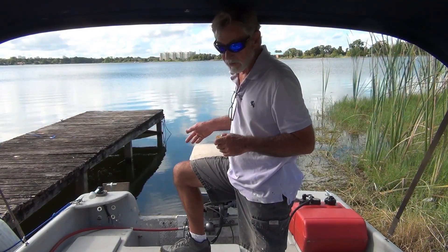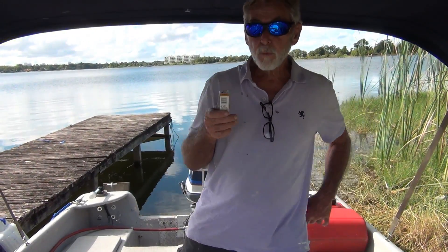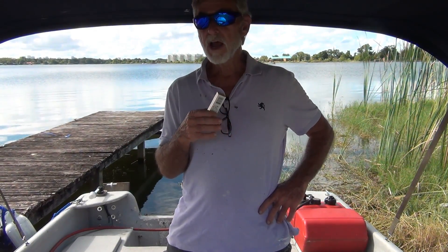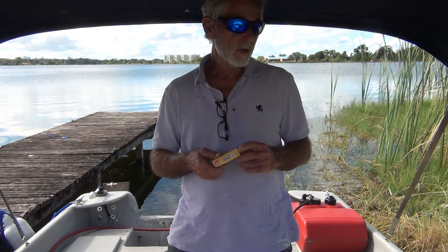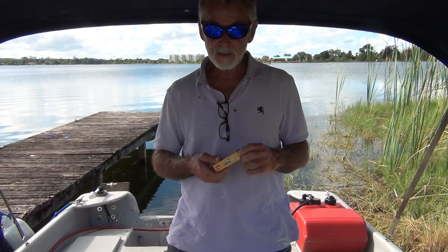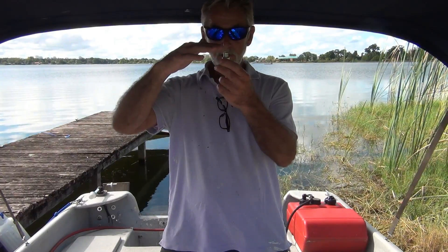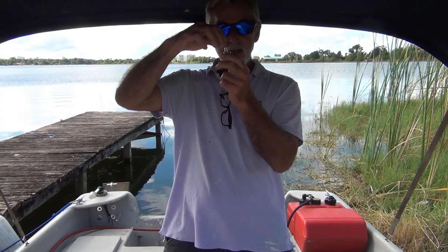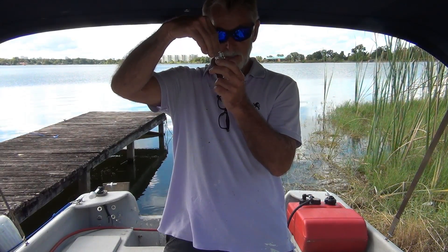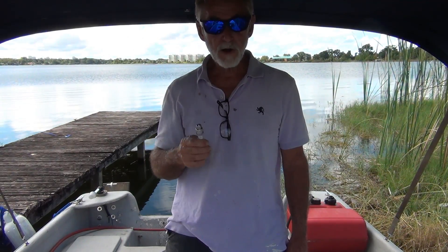Anyway, I haven't pulled those other plugs out yet. I went down and bought two more sets of plugs. I'm going to do a little experimenting. I'm going to gap one set at 32 to see what happens, put those back at 30 to see what happens. And on the third set, I'm going to do a little thing they call half-gapping - where instead of having the electrode come all the way over, you file that down so it just meets it halfway. I'm going to do a set like that and see which one of these things this motor responds to the best.